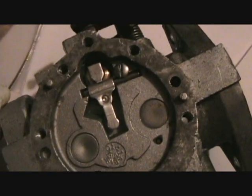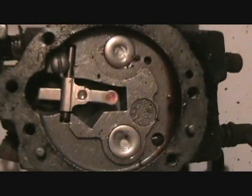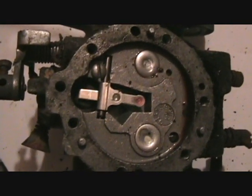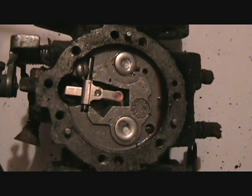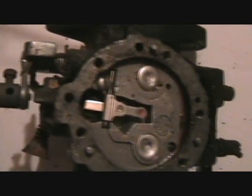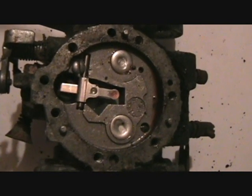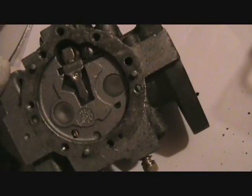This one is nice and clean — you can tell it was cleaned before. New needle, new seat, all that jazz. Now, most of you guys who know your stuff are probably saying the '69 Olympic has been sitting for a couple of years, it's got a steel tank that's probably rusted out. Well, actually the gas tank was pretty well almost empty. It's got fresh gas in it right now, the fuel line was clear, and there's a new fuel filter on it. So that's not the problem.